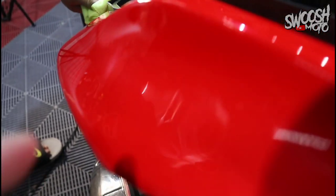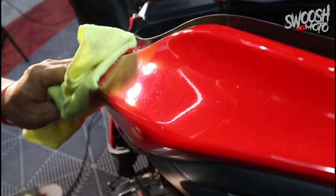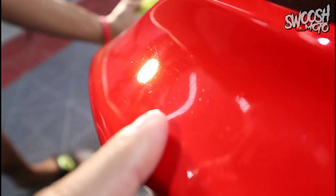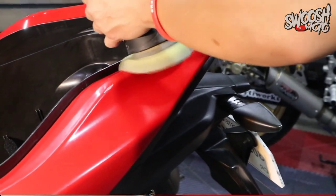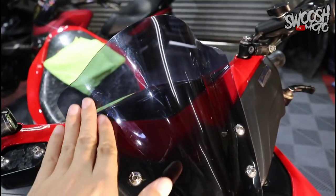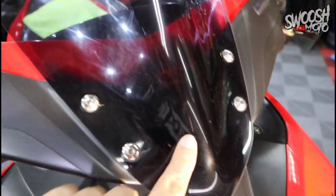It's step two now — but look, there's still a final touch to come. The glitters have come out and the hairlines — if you noticed earlier there were many swirl marks like circles — now they're almost completely gone. Not just fairings, they can also buff visors like this one, which had hairlines. Let's see if those can be removed too.